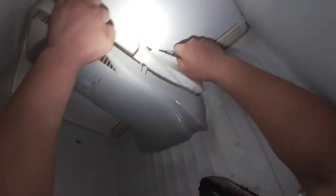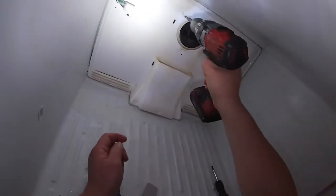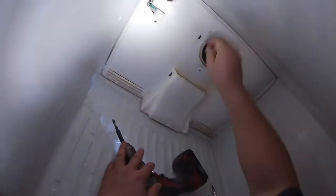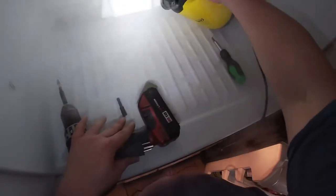This is a one-quarter screw holding the front panel evaporator fan cover. Sometimes there's ice around it, so if you have a hairdryer, go ahead and defrost the ice buildup around it, then release those tabs to release the cover. At this point I still have it plugged in, but for you it's best to disconnect the refrigerator to avoid electric shock. Be prepared for water to spill down because you are defrosting ice. Just put a little bucket or a rag to catch the water. Once you defrost around this styrofoam panel, you'll be able to access the back panel without inconvenience.